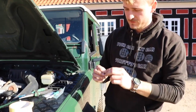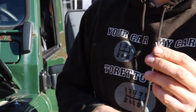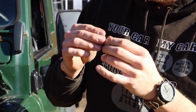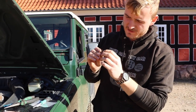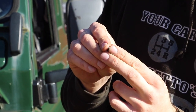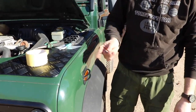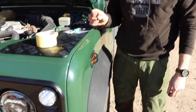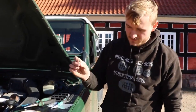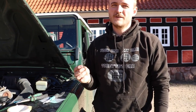They're not coming off. Other than that, you get this little Torx head. Of course, it's called the Torx TT10, and as you can maybe see on some other close-up, there's a tiny hole right in the middle of it. And you need to keep this head, as it's vital to getting these off again or changing them out, if you want some other ones or if you dented them or whatever the reason is. So keep this one, save it somewhere, very precious, where you can then forget about it in about 2 years' time.